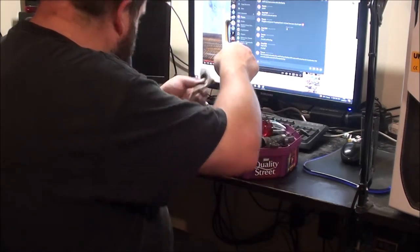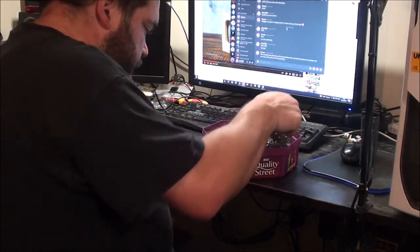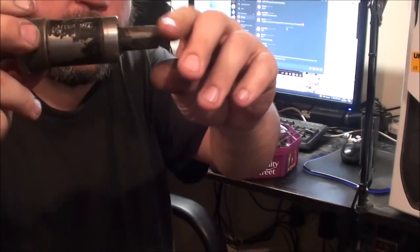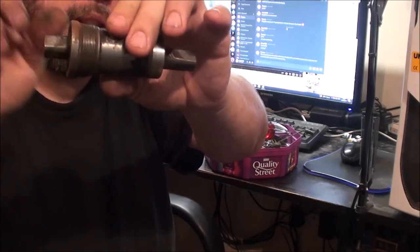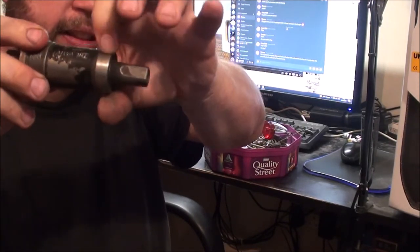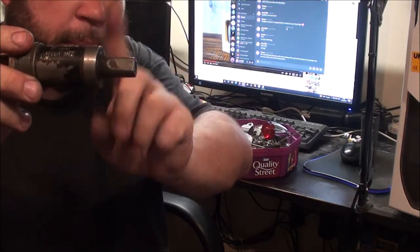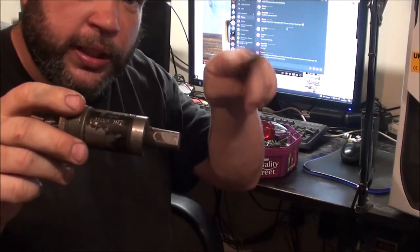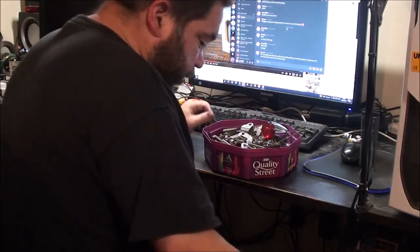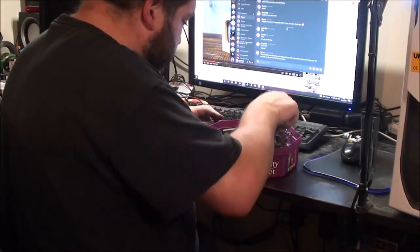There's a couple of these bloody lights. And a sealed bottom bracket. You see, I can tell that one's a sealed one. At this end, which is all sealed, your bearings are in there. Then you've got the other bearing here. Semi-sealed ones, the bearing this side is in the cup, and it's got the caged ones, the balls in the cage. But that's still a good one, and I've still got the cap for that somewhere.